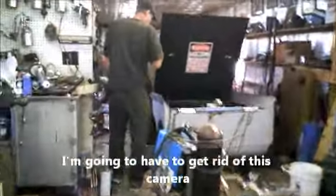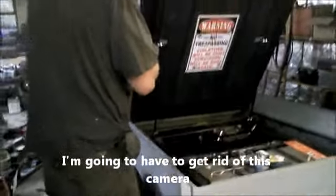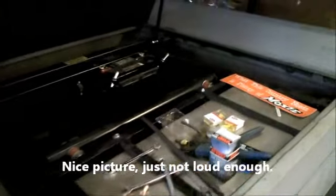I've got some wiring back here. The battery's all tied down. I've got my ground cable on there, back here, and I've got to run a red one up — it goes from there to the starter.